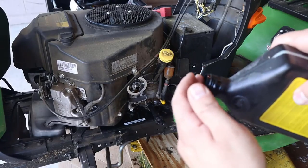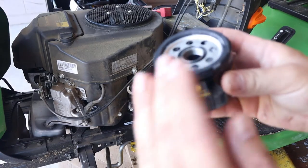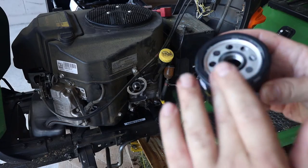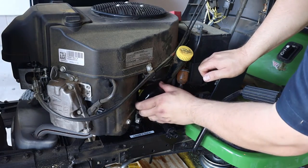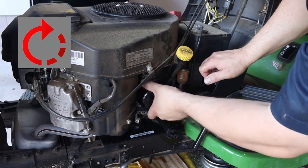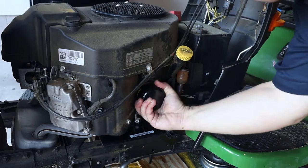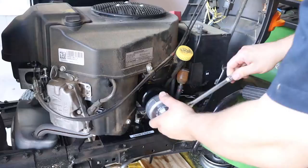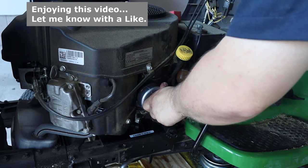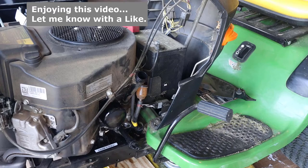Let's get started on the new filter. First, put a little dab of oil on your finger and rub that oil on the gasket at the top of the filter — you want to get that nice and coated. Then just slide it on and tighten it as much as you can by hand. Once you can't tighten it anymore, come back and do maybe a quarter turn with your socket wrench. You don't want to over-tighten — sometimes I do less than a quarter turn, depending on how it feels.